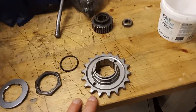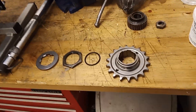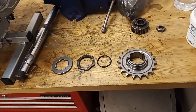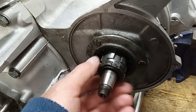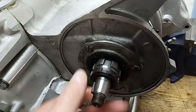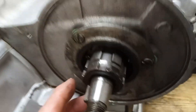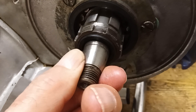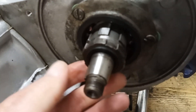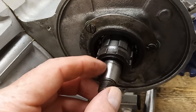It's a total pain so always worth replacing. I think this is an 18-tooth sprocket, which appears to be standard — I think there's a slightly bigger sprocket on the G162. The 18-tooth came off here. We're going to be putting this sprocket onto the high gear bearing so it's going to slot on there. On the inside of the high gear there's an oil seal that stops oil sneaking down the shaft.